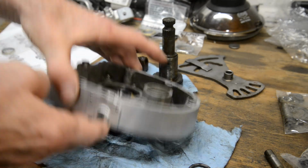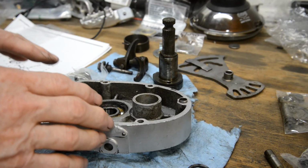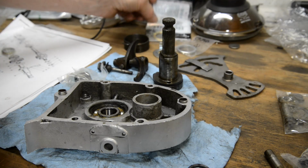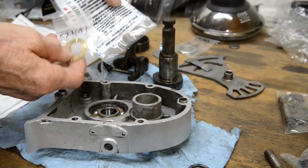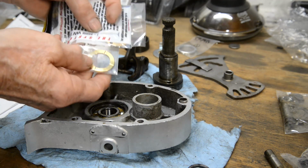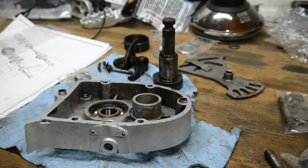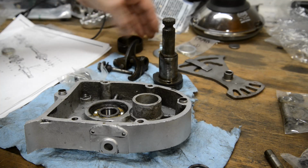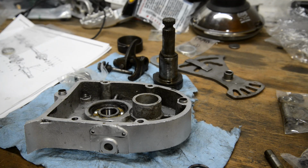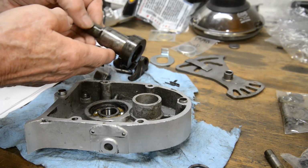our, this is the inner gearbox cover, so this is going to have all the gear change on it and everything like that. I've just discovered, as maybe when I was ordering bearings as well, I ordered two of the bronze bushes. Well, it's a thrust washer rather, that go at the back of the gearbox. Why I ordered two, I don't know, but I've got all the new bits I need for the kickstart and everything. So our first job, because there's that little needle bearing that goes inside the kickstart mechanism.